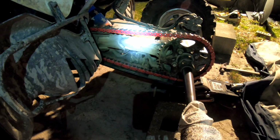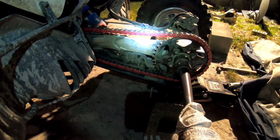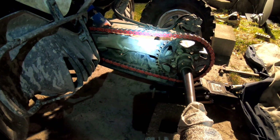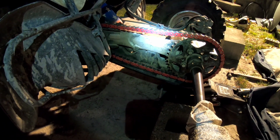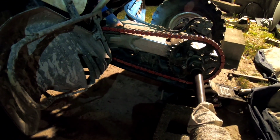Yeah, you guys, that was Chuck. He was saying that if it's a new sprocket, new chain, new front tooth as well, it's gonna be super tight. And so I told him, yes, it's at least 3/16 of an inch too short. So I'm gonna have to order me a half link. Hey Chuck, I appreciate you responding.